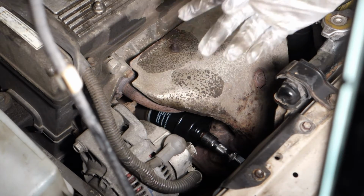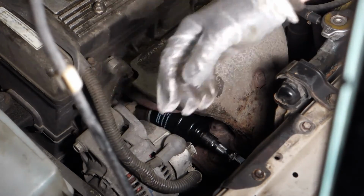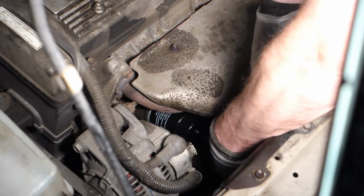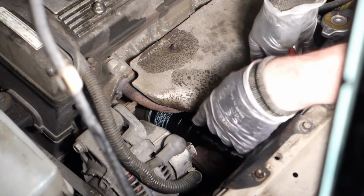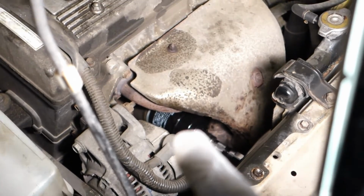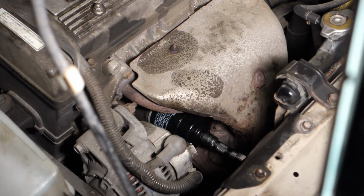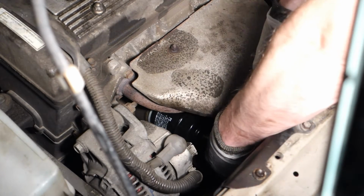An idea is that when we open this filter, it is always anti-clockwise, in that way that I move my tool from here to here. And next I show a little bit that when I rotate my tool, we can see that this filter moves well. It is also good to insert this oil canister below the car body, because quite soon oil is coming from the leak between the engine and oil filter. Soon there is oil coming, and I take this tool away now.